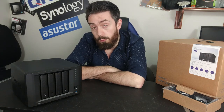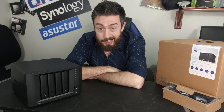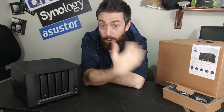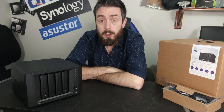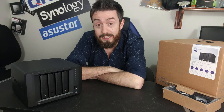So first let's talk about the hardware inside this device. It arrives with an Intel Atom — yes, it's an Atom C3538 — a quad-core 2.1GHz CPU. Not GPU-embedded, but in this case it doesn't need to be. It's a CPU that Synology have used for a very long time, and a number of you will be surprised that this didn't get the benefits of the AMD Ryzen embedded processor, the V1500B, that a couple of the more recent plus series NASes — the 1821 and the 1621 — already received.